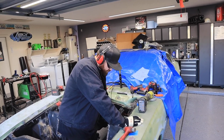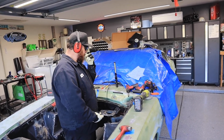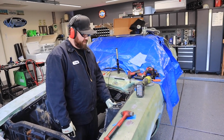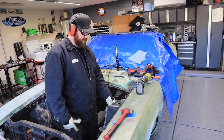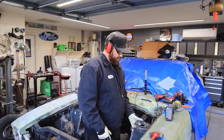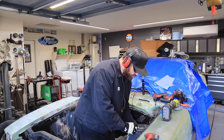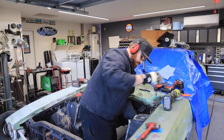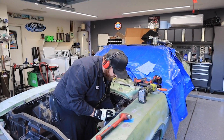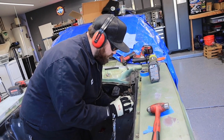Almost wondering if I should just do that. Get all the room? No, just instead of turning it around, changing the bolt pattern, shouldn't really make a difference, I don't think. No, that plate can get installed either way. But if I just slide it back, that way it just keeps everything factory, just moves it over. Either or. Try and put that as close to that as possible. Like that. Leave a little room for a weld.